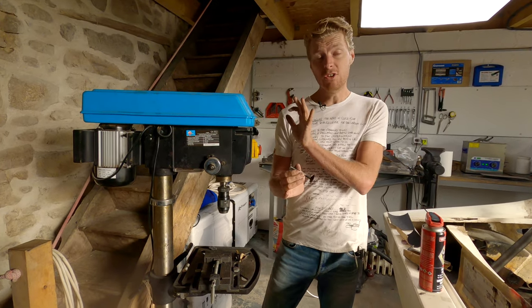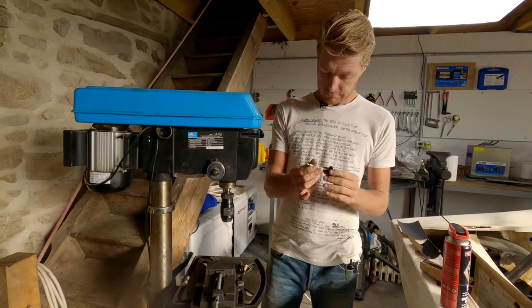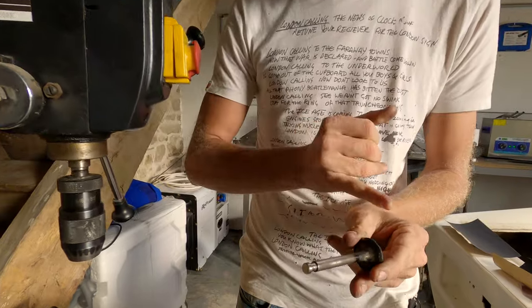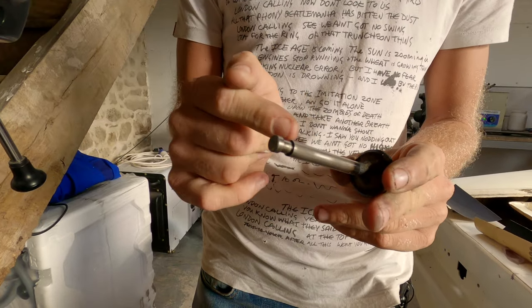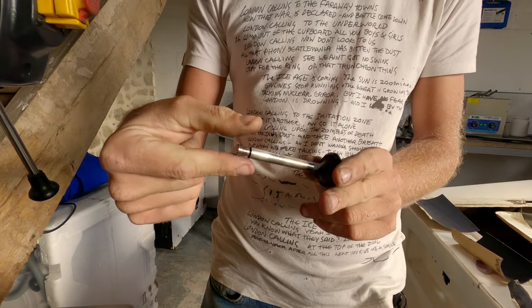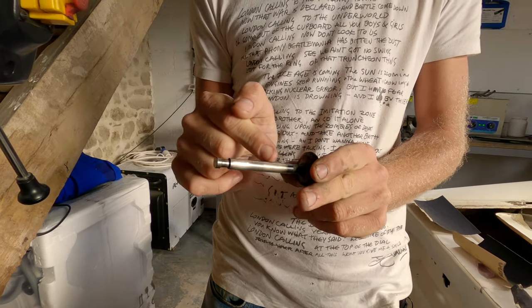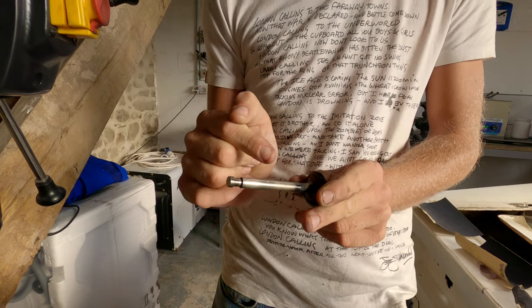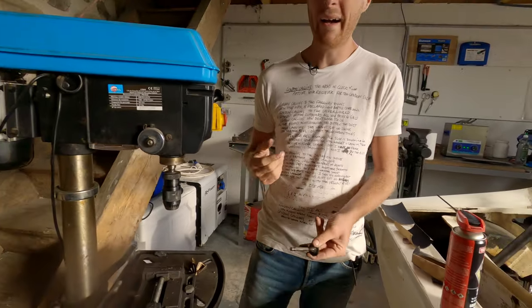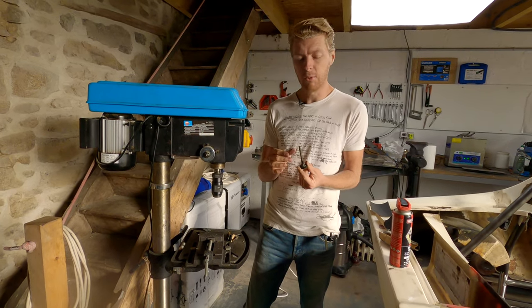Now, if you're going to use this method of cleaning valves, it is kind of the most efficient way, then you need to be really careful, because if you look at your valve, obviously ours is in three colours, but you'll see a lighter area and then a definite line and a darker area. Now, this darker area is where you want to clamp your valve, and you don't want to do it too tight, obviously, but whatever you do, you don't want to scratch this area, because that's where your valve guide lives, and if you scratch this, that'll lead to leaky valve guides, a smoky engine, and premature wear, and then you're going to end up rebuilding your heads again in 2 minutes. So the best thing to do is just proceed with caution.